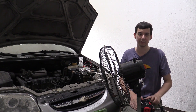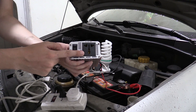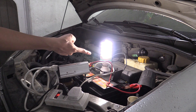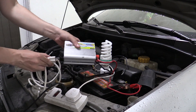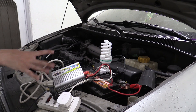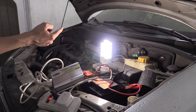Let me bring the camera closer so you can take a better look. You can see I've got my DC to AC inverter from CDR King — it comes with these clamps to go directly to the battery. I just plugged an extension cord into it so we can get more than one socket. The CFL bulb comes on and the fan comes on. The only thing I'd recommend is to make sure you buy one with a built-in fan, because some don't include a fan and they overheat. This is how you're meant to run it with the engine going so you don't drain your battery.